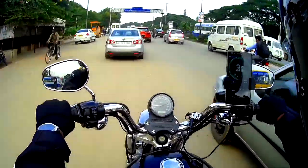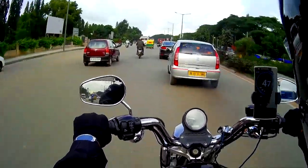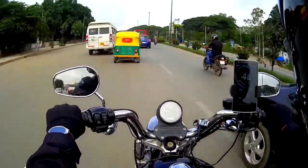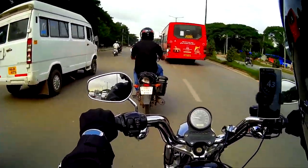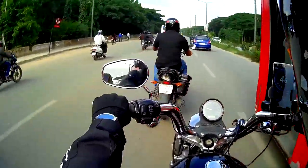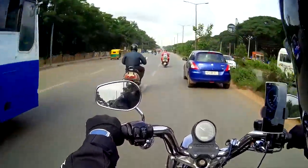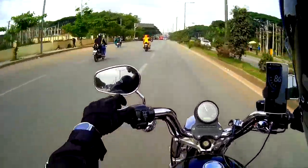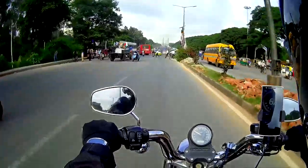The way they ask you to connect this, Kuryakyn says you should connect it directly to your battery, which I don't like, because then it stays powered on all the time. As some others have said, especially in India, when you're parked in a public place, somebody could just charge their phone from your motorcycle, and that will drain your battery a little. And it's a USB solution, so there has to be circuitry which does the 12 volt to 5 volt conversion. In this case, there is a small sealed box, so it's waterproof. And for me, it sits under the seat.